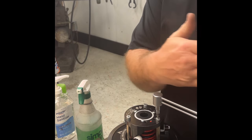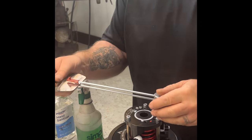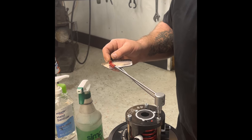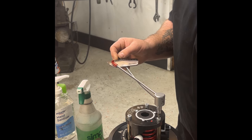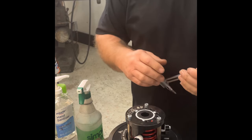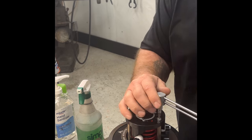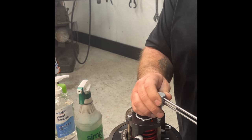Keep in mind I'm straight away. Now if I take it and run the tool in over the clutch and check it that way, I'm up at 75-inch-pounds. So doing it straight away gets you more leverage and a truer reading on the spring. About 55-inch-pounds, right when the helix starts turning.